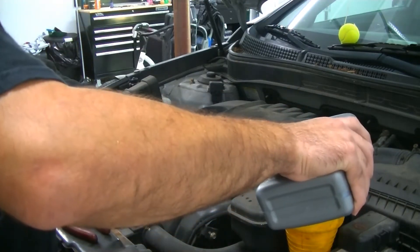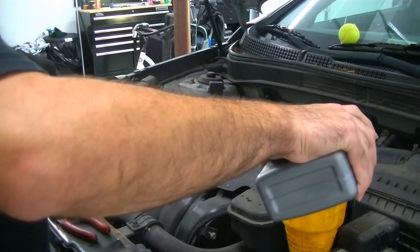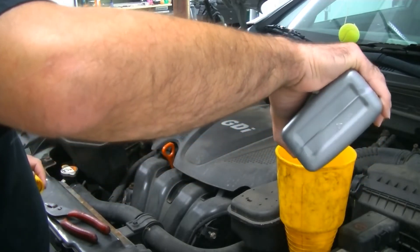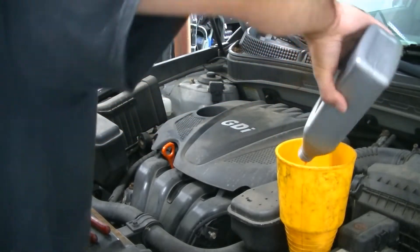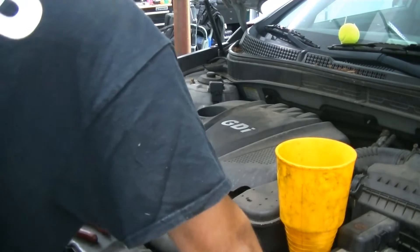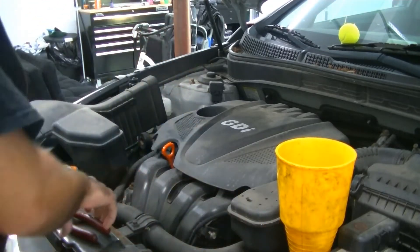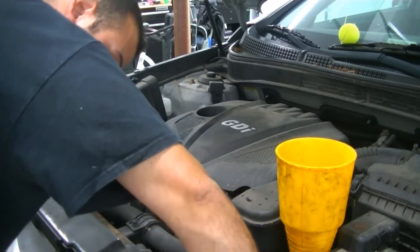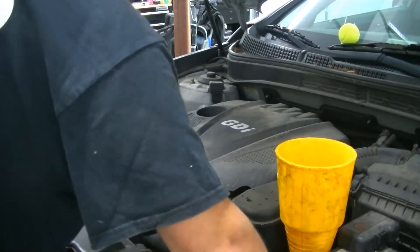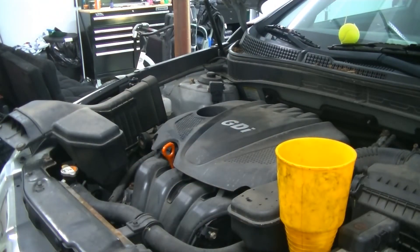After we put this fifth one in, we're going to reconnect our transmission cooler line — that is huge. I have forgotten to do that before and yes, it makes a huge mess, so please learn from my mistakes. As soon as I'm done adding fluid, I drop all my bottles on the floor and then I put my cooler line back on — that way I know it's on. We're going to put the clamp back on, reconnect our starter positive wire, let this funnel drain into the trans a little more, and then I'll show you the adjustment procedure.